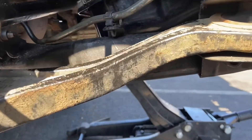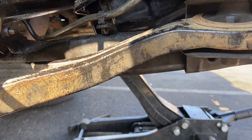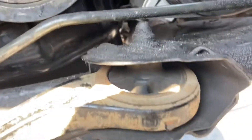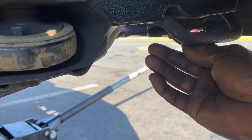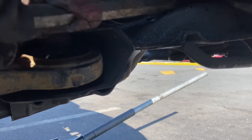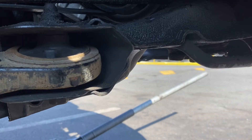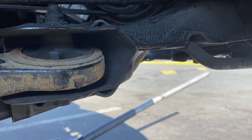See my jack right there, still on the floor — you need to jack up the engine by the transmission. Pretty much the job is completed. All you need to do: loosen this bolt right here — loosen it, but don't take it off all the way. When you loosen it just enough, then use a pry bar to pry down, put something on it right there to hold it down. Do the same on the other side, because every little inch of space helps you get that pan out when you're doing this kind of job.